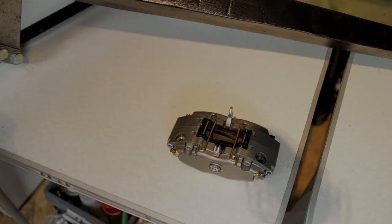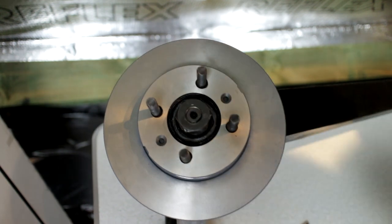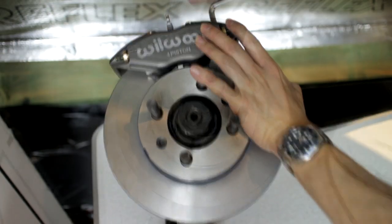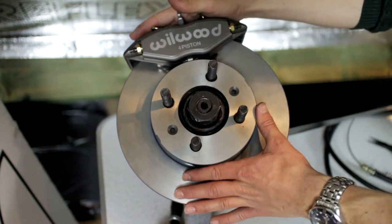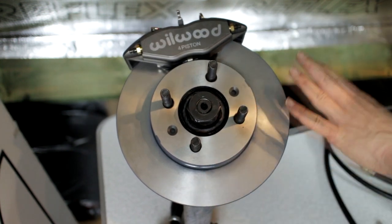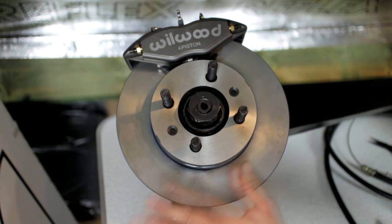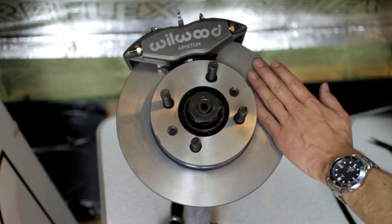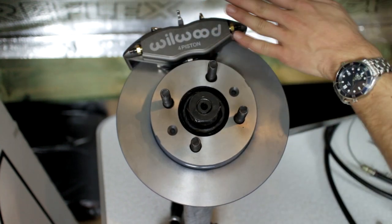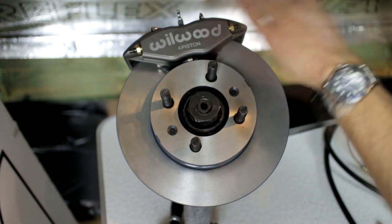To mount the caliper we're going to use the supplied bolts and spacers. This is how everything fits together. We have a 240 millimeter disc which is off the shelf from MG — for a pair of discs you will pay 25 to 30 euros. They're readily available and don't need to be modified in any way — they will fit straight on. With the brackets you can bolt on the caliper, which is standard and can be bought from Wilwood or one of their distributors, and it will fit right on. You don't need to modify anything. Pads are readily available.